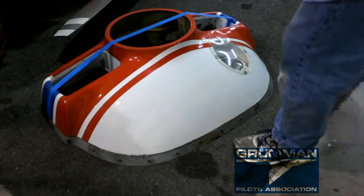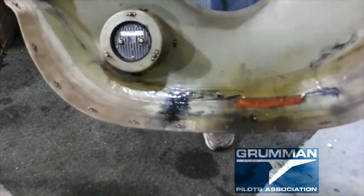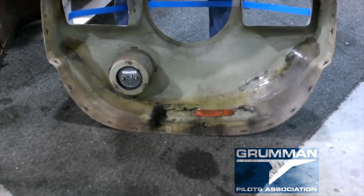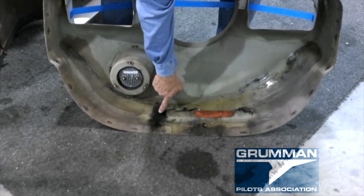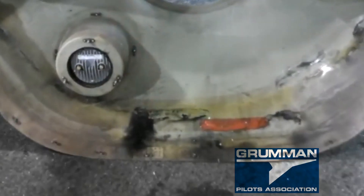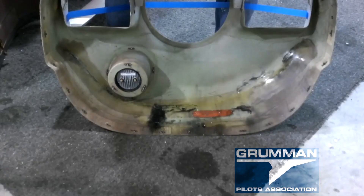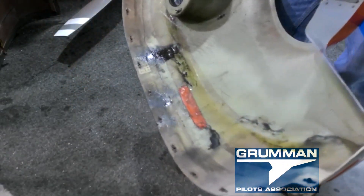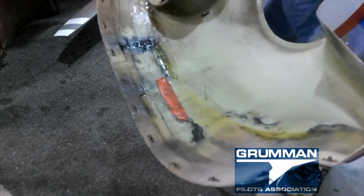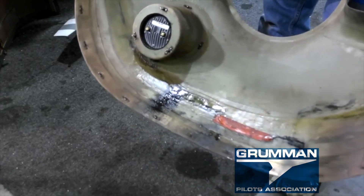Now the nose bowl is off. This is an LED landing light, so when we put it back together we'll need to observe polarity. This is a very particularly clean nose bowl. A couple of things we noticed: there is an oil leak up front somewhere — looks like cylinder number two — but we're just here to do the split nose bowl and will make a notation. Also, the baffle seal is at the end of its service life, we noticed a couple of cracks in the baffling and a couple of places where air is leaking. We'll write some notes and let the customer know he can address all these on annual.